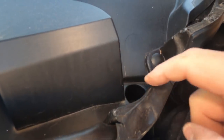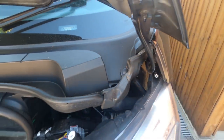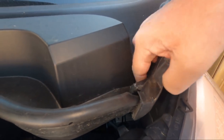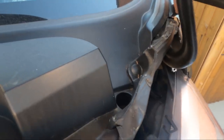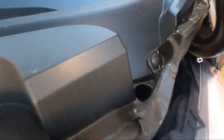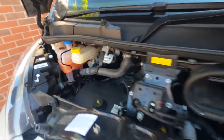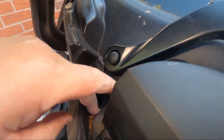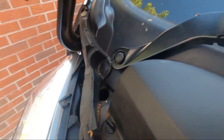These are quite important. These are your drain holes. You'll find these in the corner. Just make sure they don't get blocked in the autumn, or indeed in the spring with blossom. Same one over there, slightly smaller one over here. You can see bits of blossom in there.